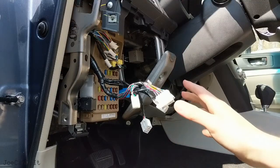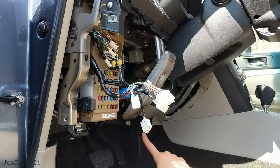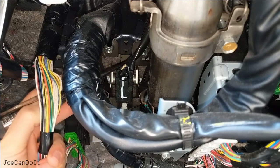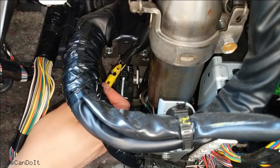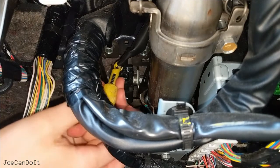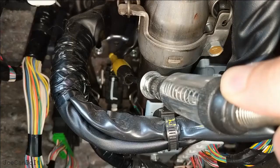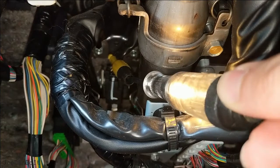For example, let's say you're working on a remote start system and you need to get to the brake light wire. That wire is all the way up there by the brake pedal, right by the brake switch. With a test light, it's very hard and awkward to test that wire at the connector. So let's instead use our tool — pull down the retaining clip, slide it over the wire you want to test. We're over it now, and we twist the knob on the bottom to poke the needle through. Just like that, we're ready to test. Here's a close-up of how it looks, and here I'm pushing the test light onto the bottom contact. I push the brake — it lights up. I know that's my wire. I made that super easy to test.